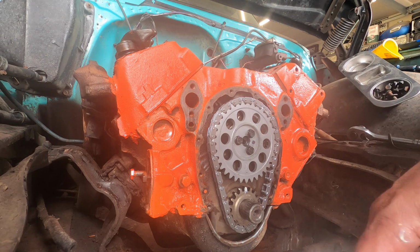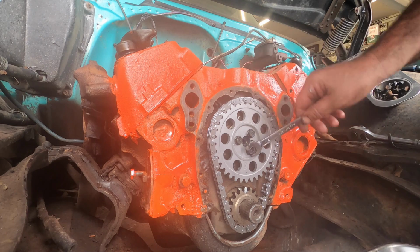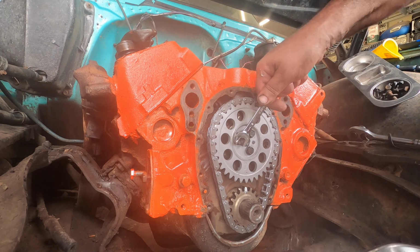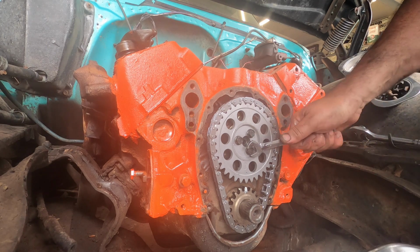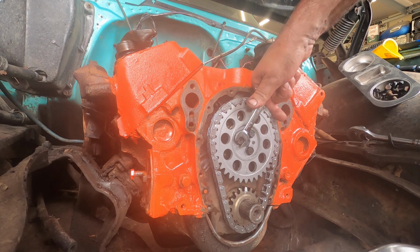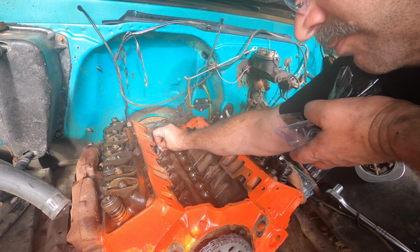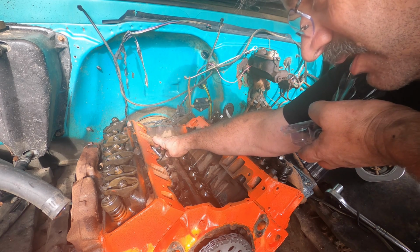Oh, I also pulled the spark plugs in. So, you have to remember, these get torqued to 20 foot-pounds if you torque stuff. I don't. So, my arthritis starts to bother me right around 25 foot-pounds. So, as long as I stop just before that, I know I'm good. So, obviously it's got a top and a bottom. The bottom to the bottom. Slide them in. Come on.